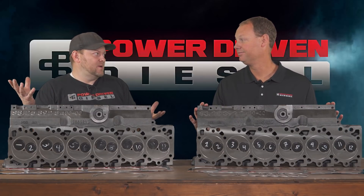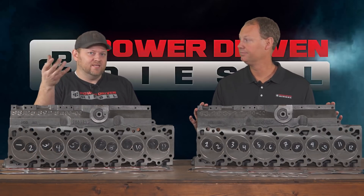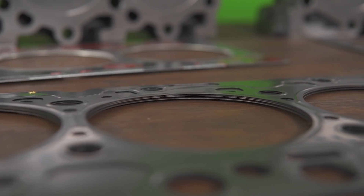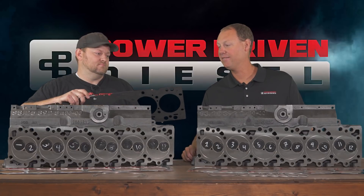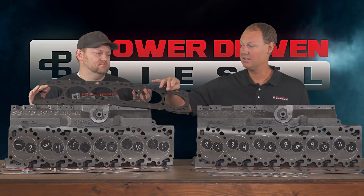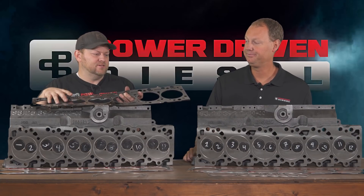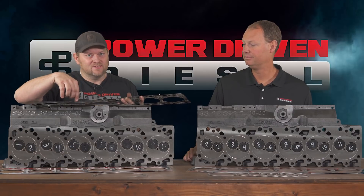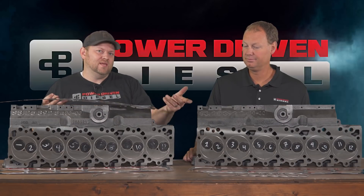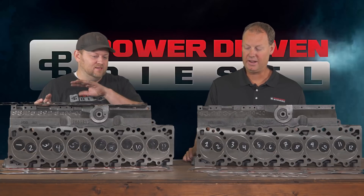Let's talk model years. From 1989 to 2002, all had composite gaskets — those are commonly o-ringed, and there's a fire ring option too, even for 4BT guys. Once you get to 2003 and the multi-layer steel gaskets, things change. Not many people o-ring an MLS gasket because the firing is different — it has different layers of steel — and with a good set of studs the MLS can be reliable at 2,000 horsepower. O-rings are generally not done with MLS gaskets, both because it doesn't work as well and because you don't really need it until you're at a power level where you need a fire ring anyway.